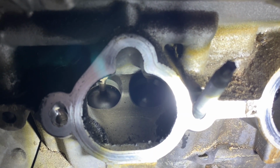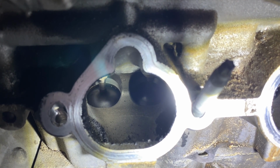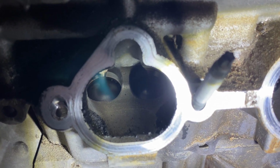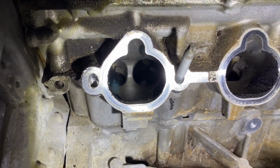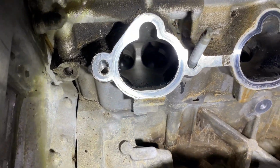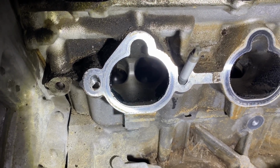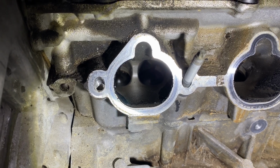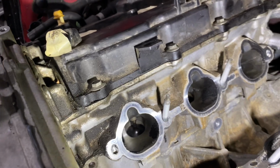So it's got a very flat plane. It runs down into a very hard, flat-edged, segregated wall between both of the intake valves. And just to back up, you guys can actually see the design of that. Okay, it's not a bad design, but with that being a completely flat split right there, that absolutely does disturb some airflow.